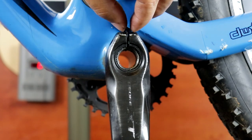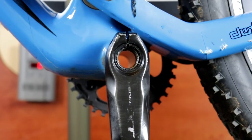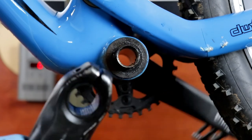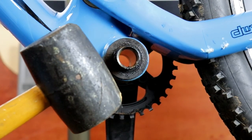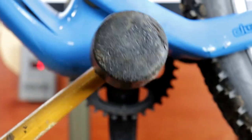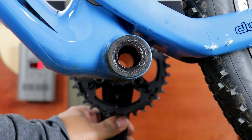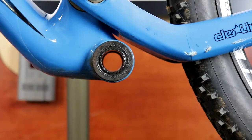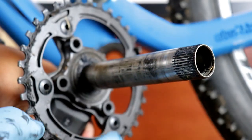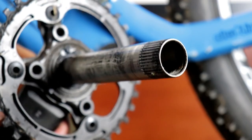One thing you're going to notice: there is a plate that sits in between the slot where the screws go into. After that, it's just a matter of pulling on it and it should come quite free. Next, you'll most likely need your rubber mallet to push this through to the other side — always use a rubber mallet. Now that that's out, just push that through and there you have it: crank arm out. If you look closely, we can see a lot of buildup of grease, oil, and dirt in here.